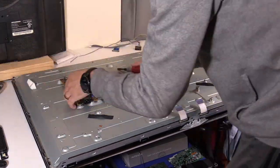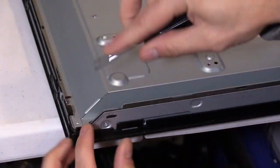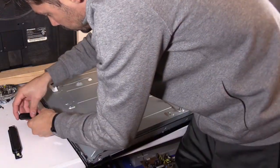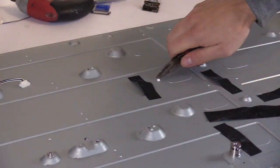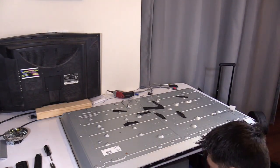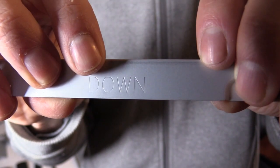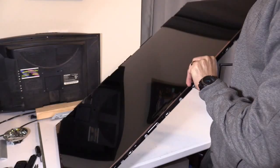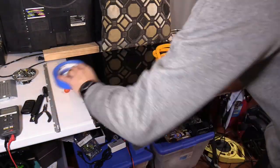Knowing this, having fixed this TV in the past and run through this problem before, I know to replace the LED strips — actually, we're replacing the LEDs on the LED strips to save some money, and you can have leftover parts to fix other TVs with a similar issue. Now get a micro Phillips screwdriver and remove all the micro screws on the outer edge, pop those clips, remove the bezel, and then you'll be able to remove the brackets labeled 'side,' 'down,' and 'up.'